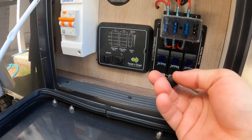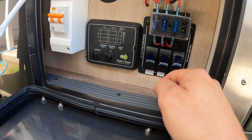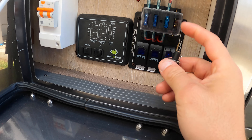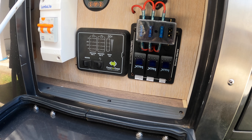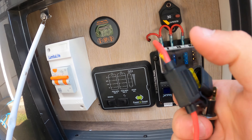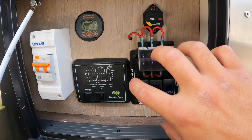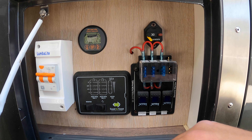What was happening is when you pushed the panel, it would contact and make the circuit. I've found a nice way to get around that — something you can just take with you just in case it happens. A quick fix would be to get one of these — just a normal blade fuse. You would isolate the circuit, make sure there's no power, pull the fuse panel out, then on the back take the two female connectors off and connect this in there.